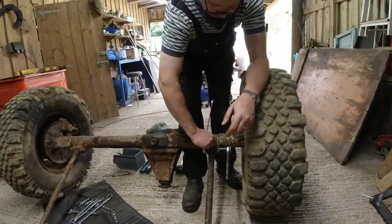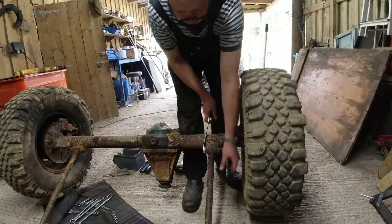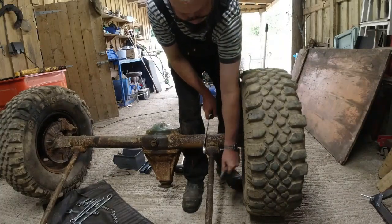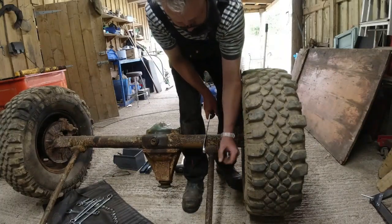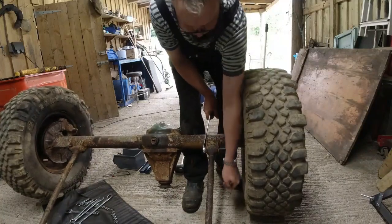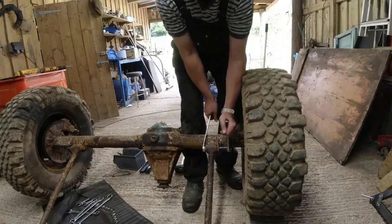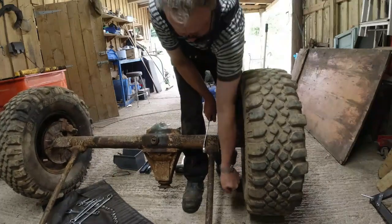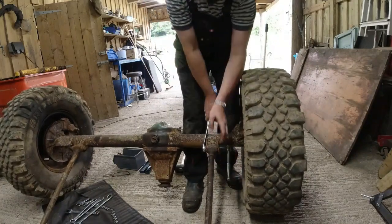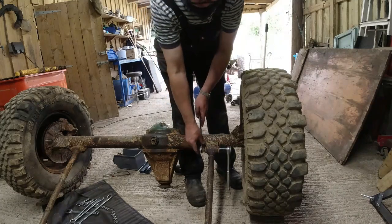So I ended up running an angle grinder down between the arm and the bracket and then rotating the bolt because I couldn't get the disc right in there, and eventually managed to snap the end of the bolt off. Did that on both sides and then pressed the bush up, complete with the bolt still seized into the stainless housing. Yeah, just because it's polybush, don't think you don't have to lube it. Other brands are available.